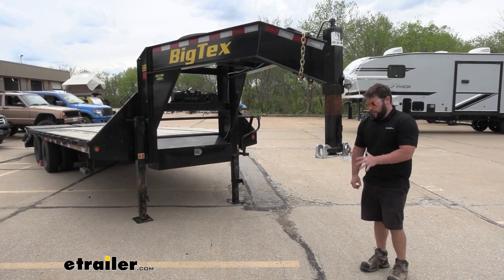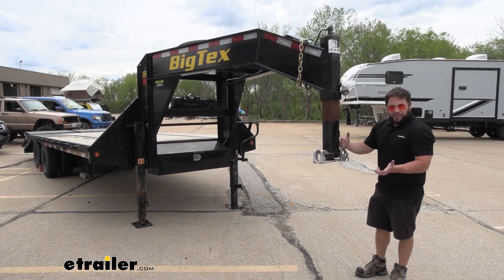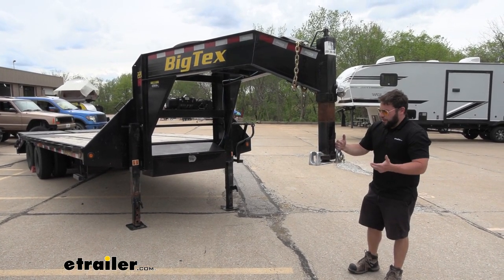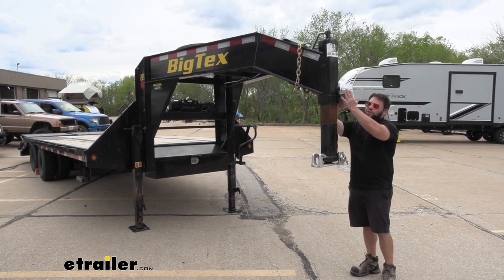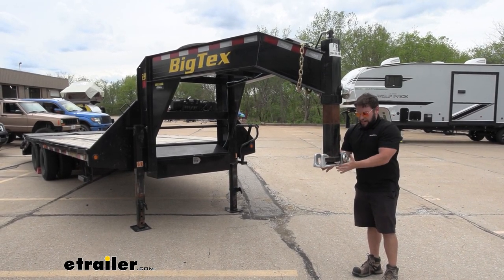This is going to be a good way to keep your trailer secure. You can buy these individually, but the fact that it comes in a kit is really nice. We have our Big Tex flatbed trailer here in the parking lot today, and left unattended without these, somebody could just come up, hook up to the trailer and pull it away. But now we have two anti-theft devices on here, so they can't remove the set screw that would drop the inner tube out, and they can't connect to the coupler.